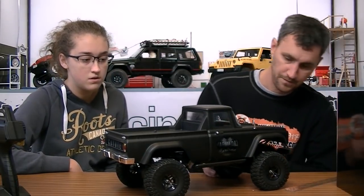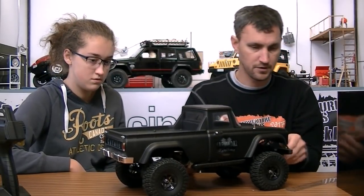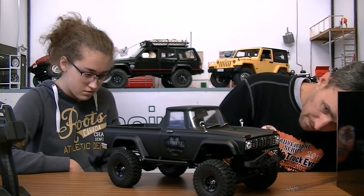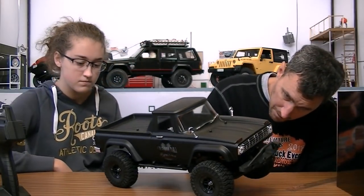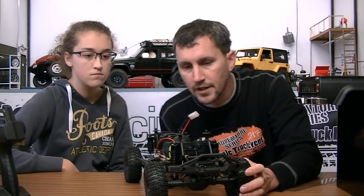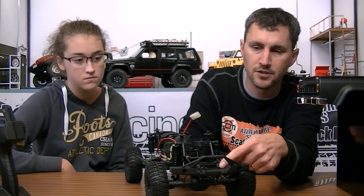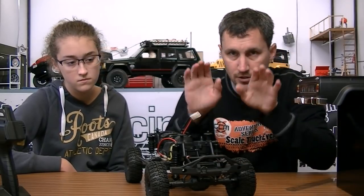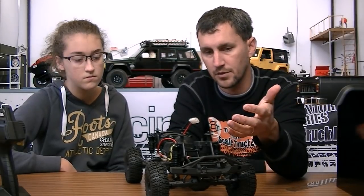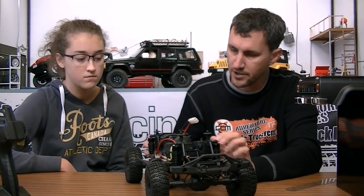That's a good tip. I think I'm going to lower the body on it right away, because there's a big gap here in the front bumper. So I can probably fix that right away. Although, this is interesting. The way the bumper mount is made, I think you can probably just lift the bumper right away, because there's a drop-down bumper mount bolted into that bracket. So I think we could probably just lift the bumper and then level the body off again.